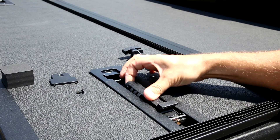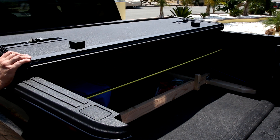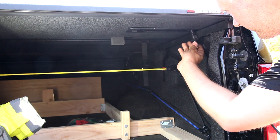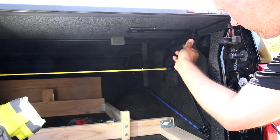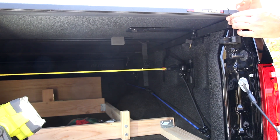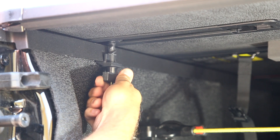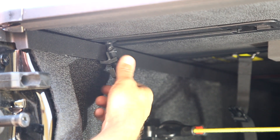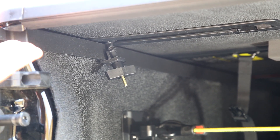Whenever I want to flip it up, I need to take this out and put it in my truck bed. I know it's a little more complicated than just flipping the speed clamp over, but I'm not doing it that often so I can live with it. Now that we've replaced both clamps, I'm going to flip the cover back over. Make sure the jaw is in the bed rail. I'm tightening it up a little bit, but not too much — just a little — because the cover needs to be able to move a little bit when we close the tailgate.